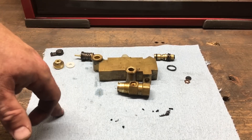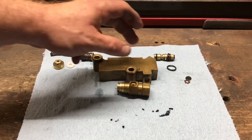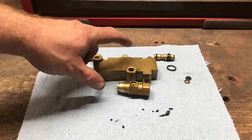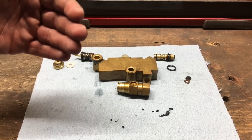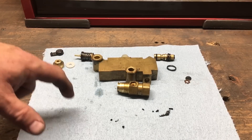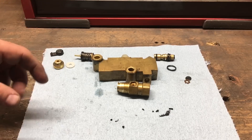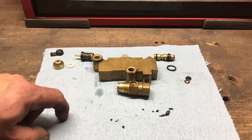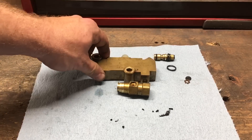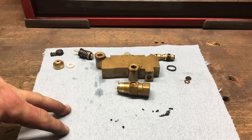Now with an asterisk — when you can't adjust your pressures, you're going to have 50/50 to front and rear brakes at pretty much the same time. Forgive me if these aren't the correct numbers, but if you don't have the 60/40 or 70/30 distribution percentages normally used for a disc/disc brake setup, you do run the chance on a panic stop of locking up your rear brakes, which reduces stopping efficiency. That's my disclaimer, because we're following something from a Saturday morning show about converting a disc/drum prop valve into a 50/50 disc/disc by eliminating the internal valving.